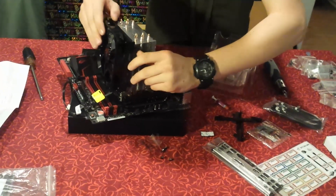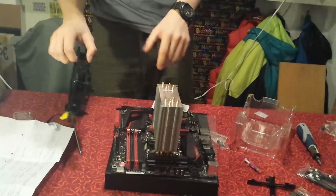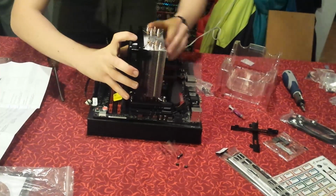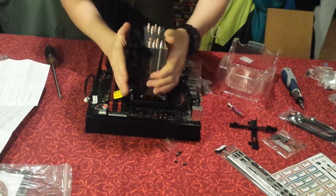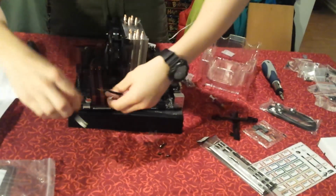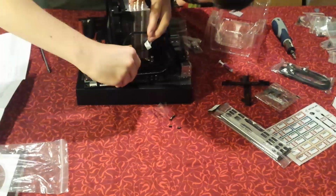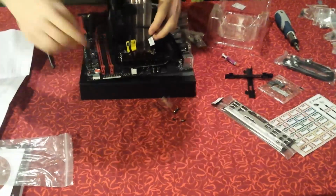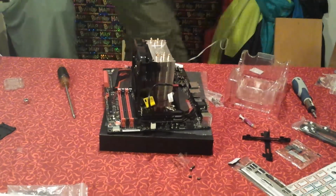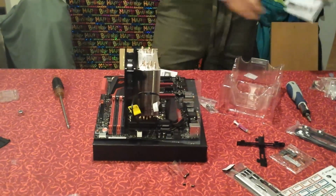Oh yeah, and these little rubber pads that I found on the fan are to prevent vibration, so that it stays as quiet as possible. I'm actually gonna get this beautifully mounted, like so. That's about as good as it's gonna get. We'll move this around. Find our pins. Insert it. Push it down. It's a bit of a tight fit. Now, RAM. These two little thin sticks that I got. Fold this up. Oh yeah, cooler's installed. It's brick solid. Everything's good.